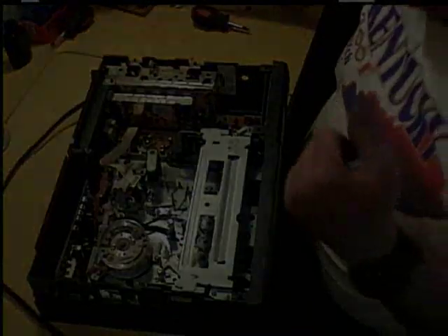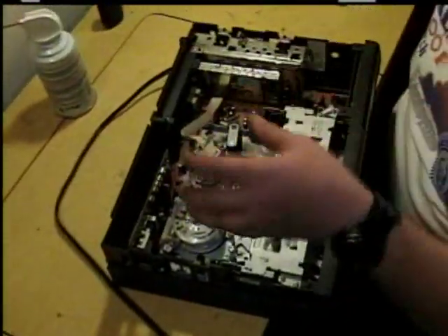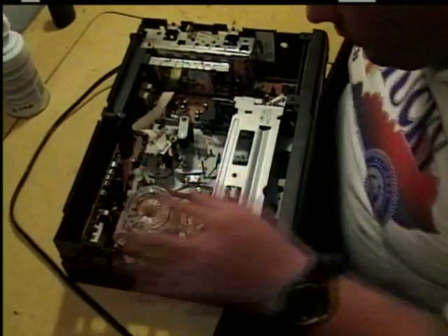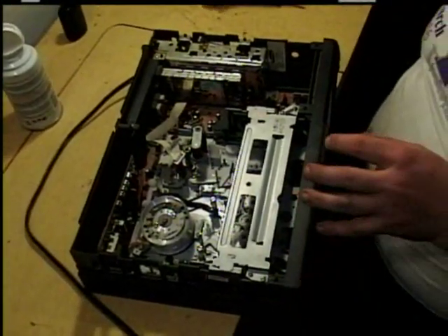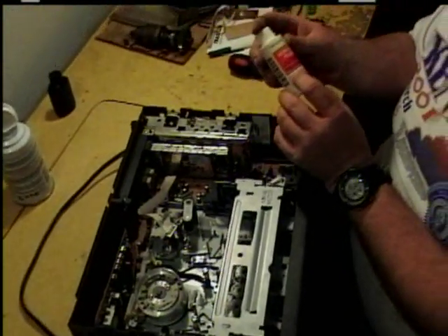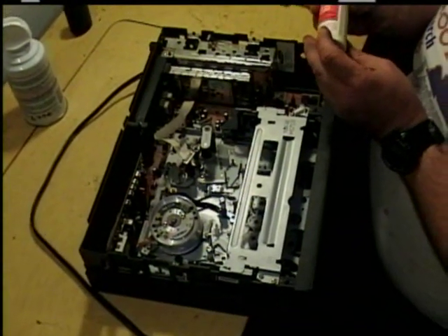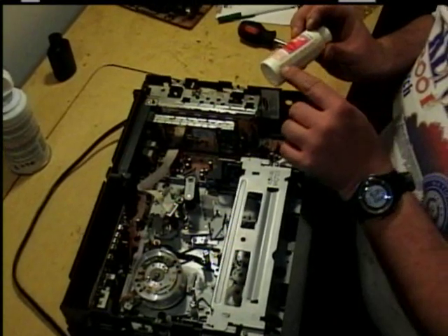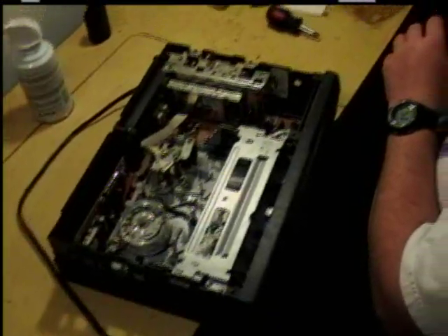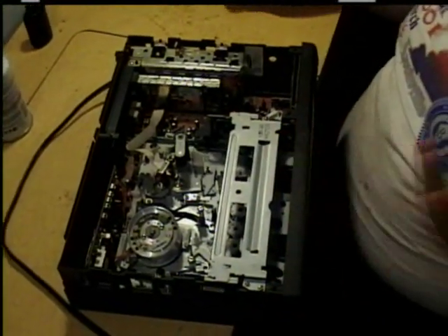Allow about five minutes for it to dry, because you don't want to put your tape in there while it's still wet. Our five minutes is up. As discussed, preferably instead of using the Teflon oil, if you've got some kind of non-conductive, non-corrosive grease you can lightly put on there for electronic appliances, that would be even better. I found some non-slip fluid here for record changers and tape recorder drives — you can clean the tracks a bit with that. It says use a swab applicator to apply cleaner to wheel or drive surfaces, and allow several minutes before turning the unit on. Use your own brand wherever you prefer.